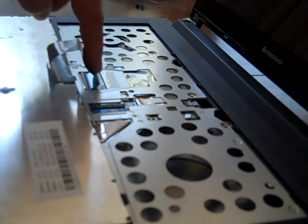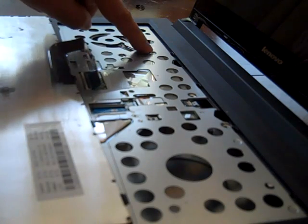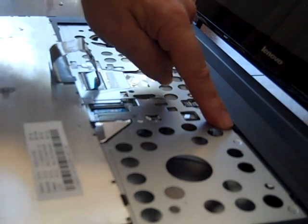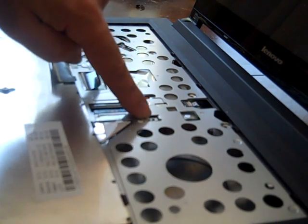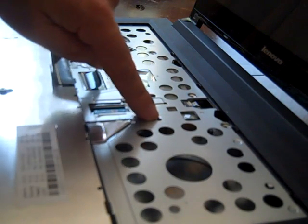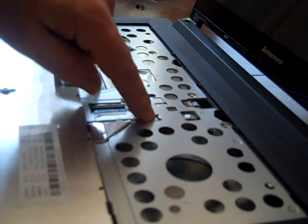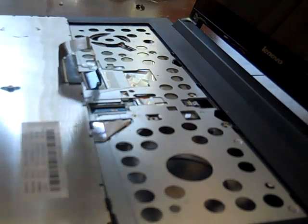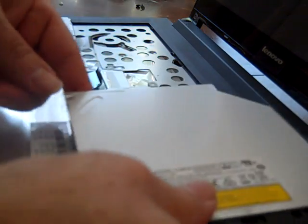I don't see any reason to disconnect the keyboard, so don't bother doing that. There will be four mounting screws, and then number five, which might happen to have a little anti-tamper piece of Lenovo tape over it — this is the screw that actually holds in the CD-ROM drive and that has to come out. This is where the CD-ROM drive plugged in, and this was the tab on the CD-ROM drive that was holding it in place.